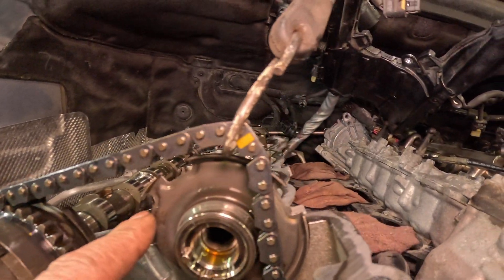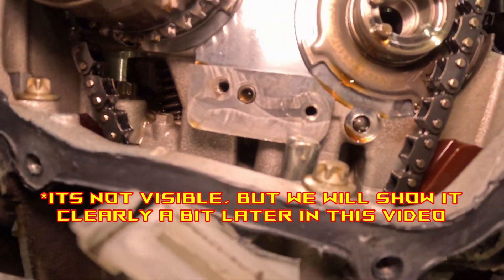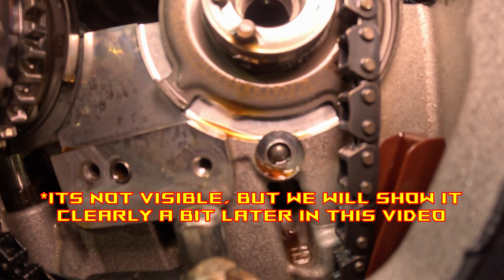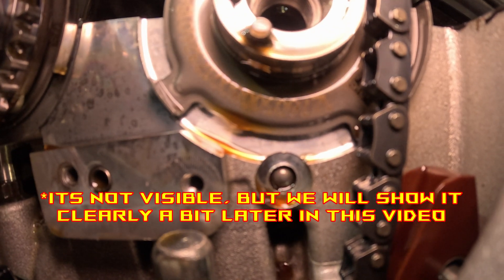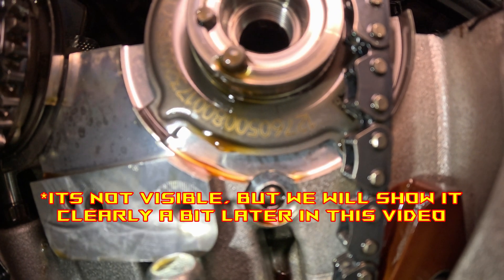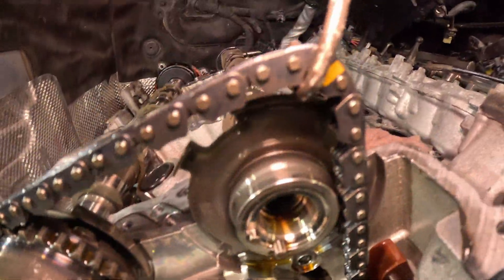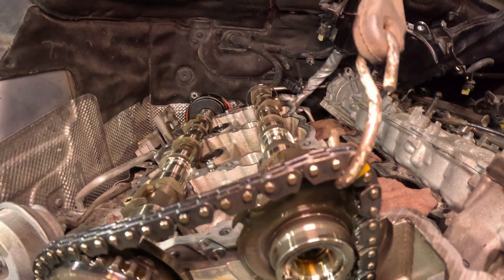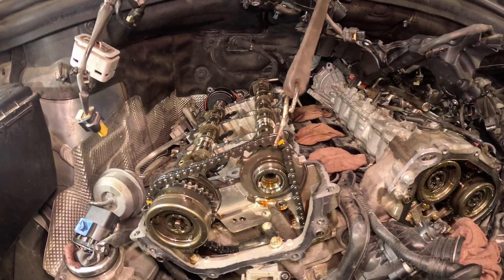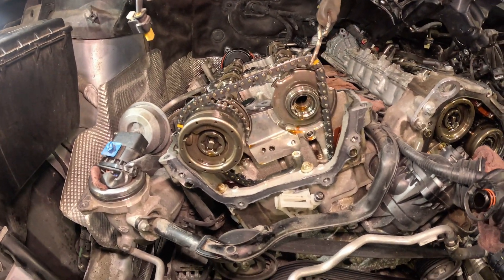There is also this tone ring — it's shifted in relation to the camshaft, about a millimeter or so. There is a mark on the bottom; it's shifted a little bit. We need to realign it back into position and then weld it. You can tack weld it to the camshaft itself so it doesn't shift again, because that is going to give you an error code as well. Very poor design for a car that costs this much money — it should be built much better.